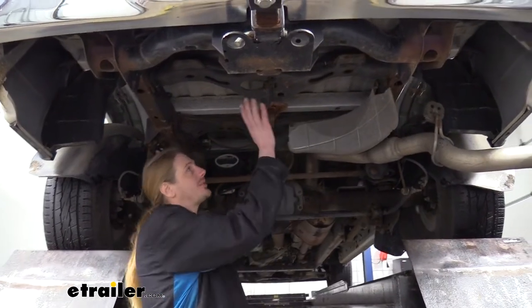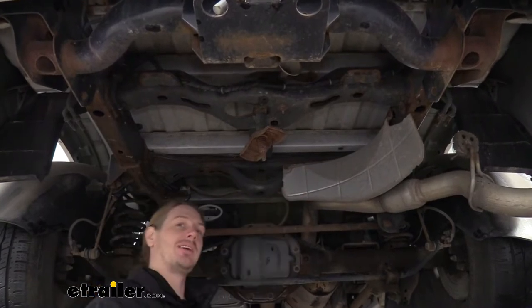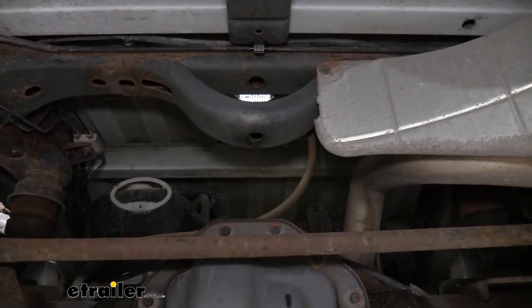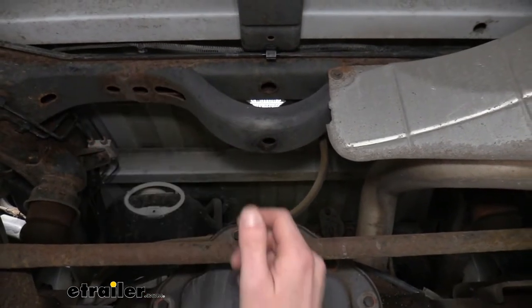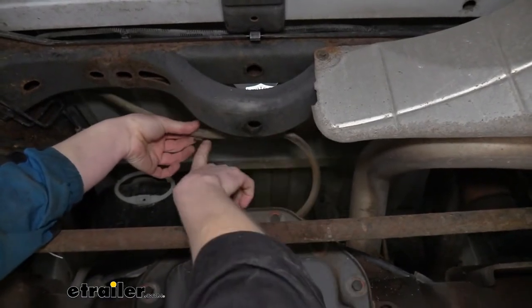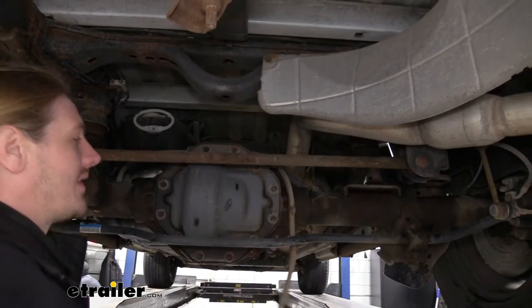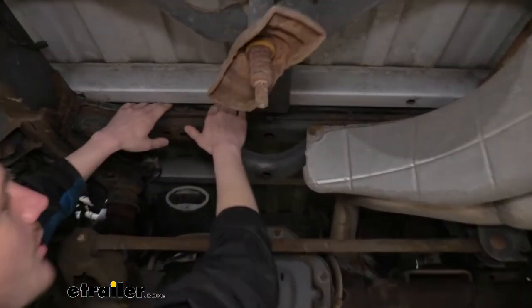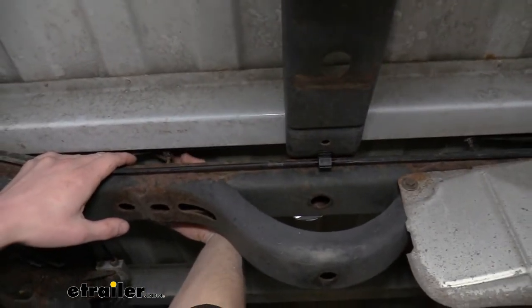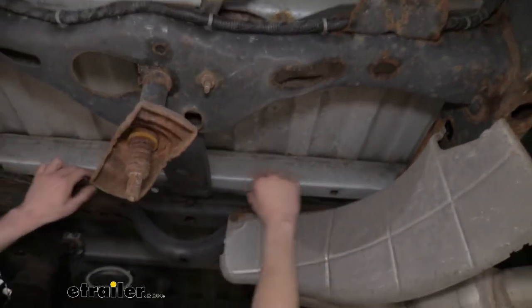We're now underneath the vehicle. You might notice our spare tire is out of the way — you don't have to remove it, but it does give you a little more room to work. You'll also notice a hose coming off of our axle that runs down this cross member — we're going to need to temporarily remove that so we don't damage it when putting our components up. It's just clips holding it on, so just grab the hose and pull it away — they slide right off. You'll also notice there's an electrical wire that runs across the top as well. There are several pins — reach up and pull these out; they can be tight so you might want to use pliers. Pull them all out until the wiring is loose, then pull it back and keep it out of the way.